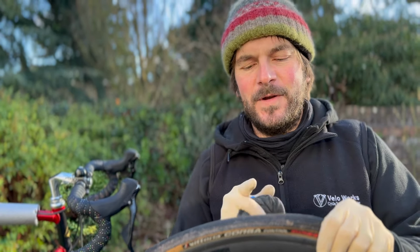Maybe I have to backtrack a little bit. Probably because the other rim is worn, the brakes are rubbing, so I'll just adjust them slightly. I didn't think I'd have to, but it does make sense if the other rim's worn. So yeah, just a slight bit. Ooh, what's that? So we've got the cable just touching a little bit. The ends of Shimano cables should be 30 mil out, so that's right. But because we've got a higher spoke count, that's just rubbing. So that's sorted now. I'll just double check the brakes.